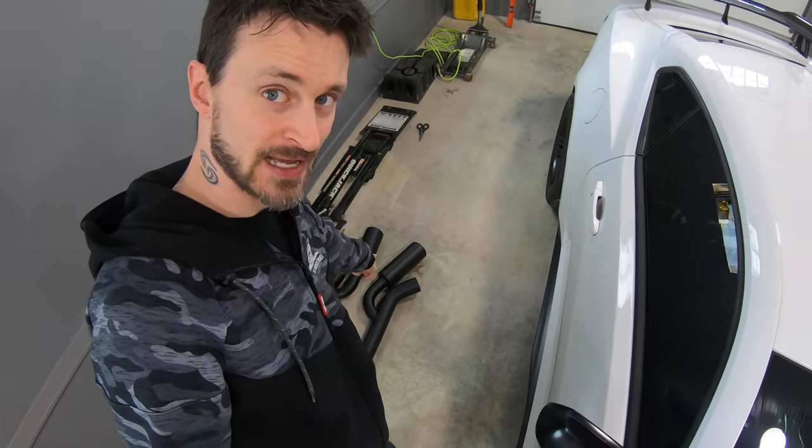So exhaust systems can be poorly made, or they can have a whole bunch of R&D behind them. Obviously, doing more R&D is just gonna make the price of the exhaust go up. So one kind of cheater mod that I think you can get away with on an exhaust system is basically adding one of those guys. What that is, it's called a Helmholtz resonator. It has several reasons behind it. And it's not that a Helmholtz resonator will add horsepower to an exhaust system, but it can help make up for a possible loss in an exhaust system if it's poorly made.